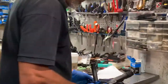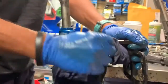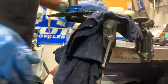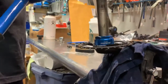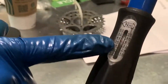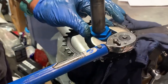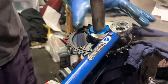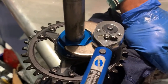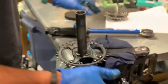I believe that every home mechanic should have a vise — it's a very helpful tool. So what you'll do is I've got just a t-shirt there, and you set your torque. It was 35 to 50 Nm, so I've got it about 43 to 44. With these wrench flats here, put that tool on there and then watch the neck right here of the ratchet. So that's torqued — this is more for the benefit of the video.